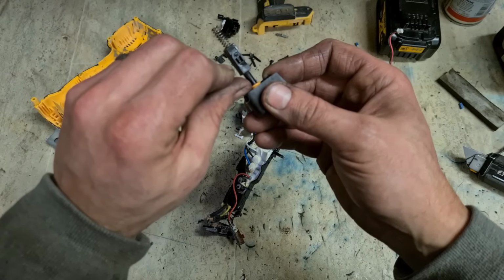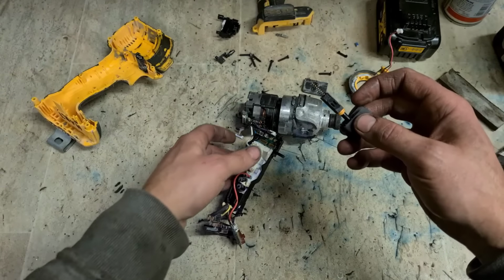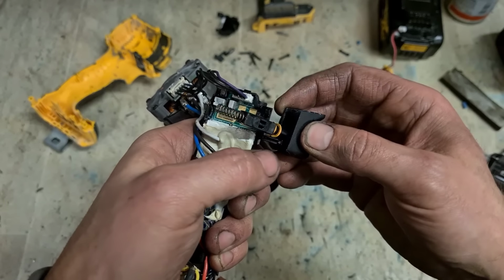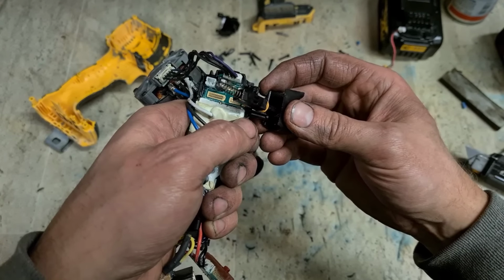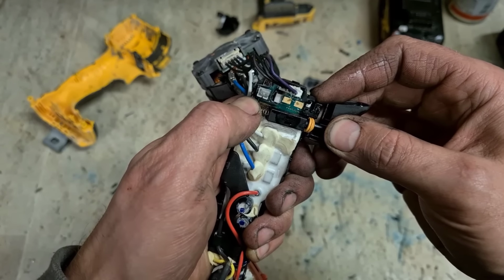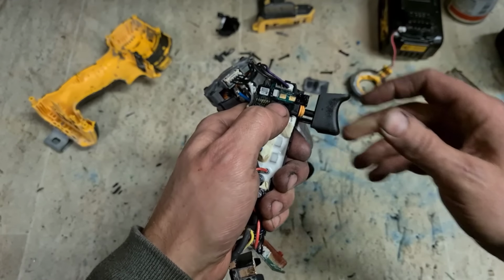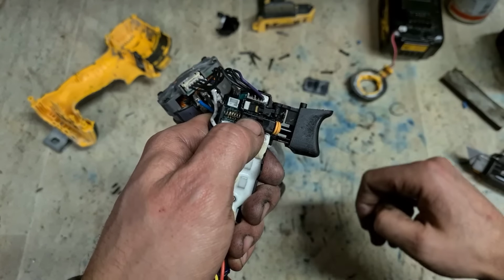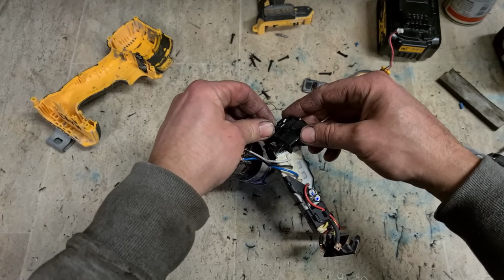Reinstall, spring at the top. These little yellow pieces here, little lip seals, push them all the way to the back. Hook on your switch lever on these wee slots and push it down, making sure these lip seals drop into here. From there on, take your thumb, push in your spring, hook it onto the side here. That's it. Forward reverse switch then, so it sits on top, pushes down. As simple as that. Quick and easy fix to keep your impactor running for a few more years.